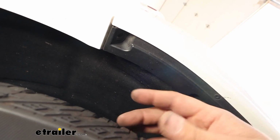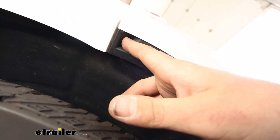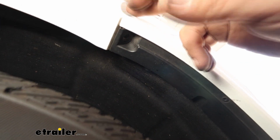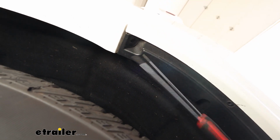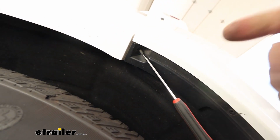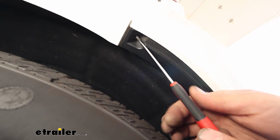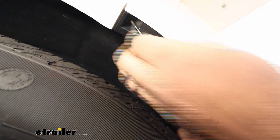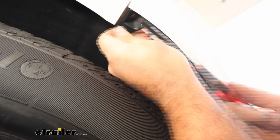Head to each of the wheel wells, and the first spot we're going to tackle is a screw that's a T15, and that's right where the wheel well trim goes from the rear fascia to the rear quarter panel, and it's just a small screw that's in this pocket. And if you look at the angle that I have the screwdriver at, that's about where you're going to attack it. So we'll get this out first. Very small, so be careful.